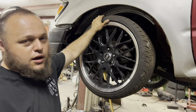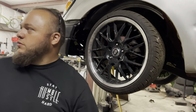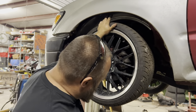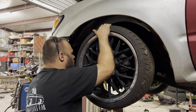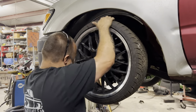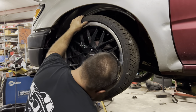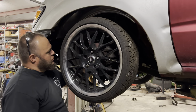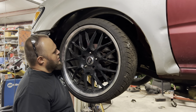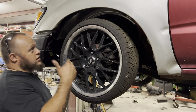I would definitely stick with 18s. You can put a 20 on there now, but when we body it, it's going to take some re-engineering. If anybody knows anything about what they do with the oil pan, let us know. I don't understand why it's stopping there though, because the bag still has some room to expand, the ball joints aren't hitting, the upper control arm's not hitting the plate, and the shock's not extended. So when you put air in it, it may actually go higher than that.